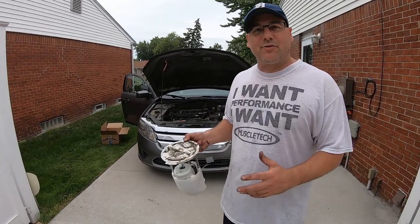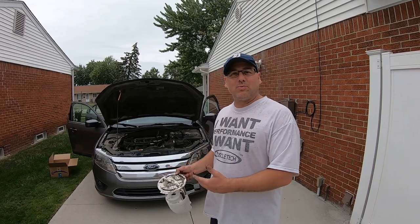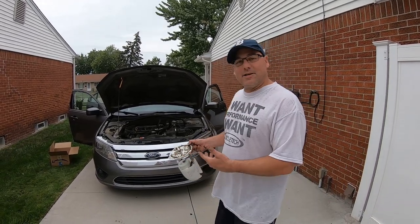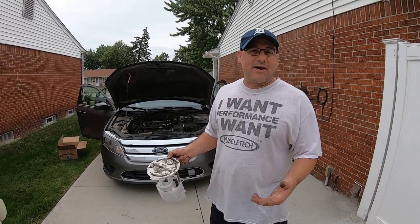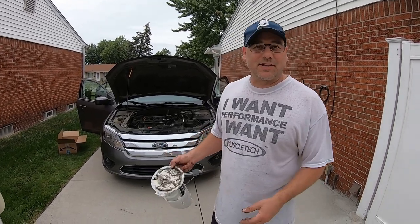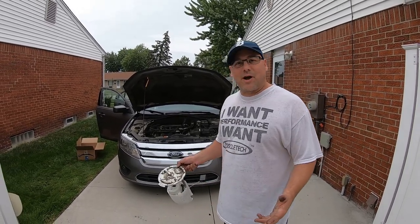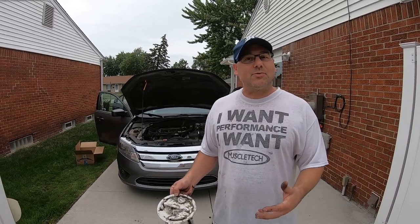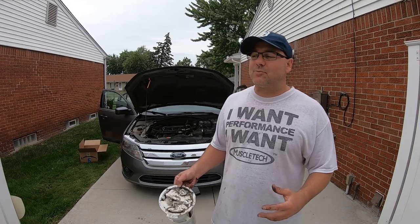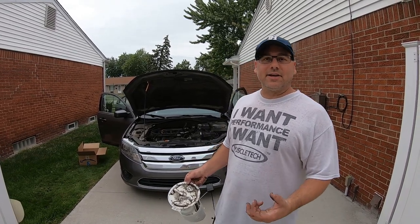That's it for this video. Hopefully it helps anyone else that has to change out a fuel pump. This pump works on other vehicles too — I think it's the Mercury and Lincoln version of this vehicle as well. As long as the fuel pump is behind the seat and you don't have to drop the tank, you can basically do what we did. And if you've got to drop the tank, it's just a little bit more work. If you can do it yourself, you'll save a lot of money. The whole project took us about one hour including filming. The hardest thing was taking that ring off — that was the only struggle. You're going to want to get a big hammer and a nice size chisel to get it out.